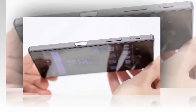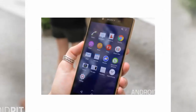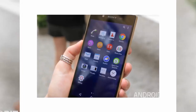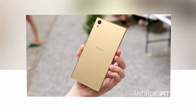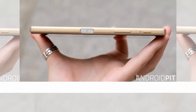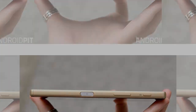It sounds obvious, but having airplane mode activated will prevent the Sony Xperia Z5 from receiving network information. Ensure this mode is turned off and make sure the same can be said for stamina mode. When activated, stamina mode pauses mobile data and Wi-Fi connections. Contacting your network provider is the next step if you have further questions. Many other Sony Xperia Z5 problems can be resolved by using Sony's PC companion tool, which we've mentioned several times above. We recommend you run the software yourself before contacting Sony over the phone.